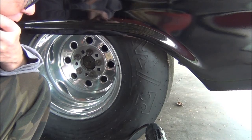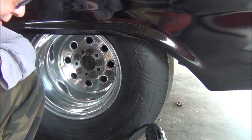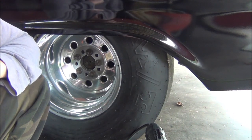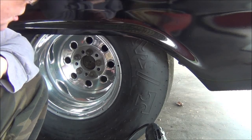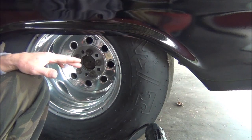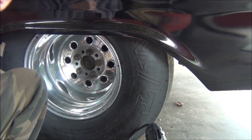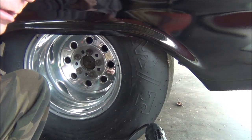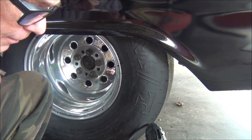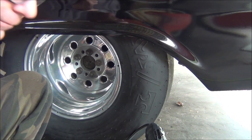So, in situations like this, when I'm drag racing, let's say I want to add a half pound per tire. Going rounds, it gets late at night, the air gets cold. You lose a little tire pressure when you wait between rounds. The longer you wait, the colder it gets. You're going to lose a half pound to a pound. And we try to keep the exact amount of air in it for each pass. So if I want 12 pounds in here, I'm going to have to set this on 15.